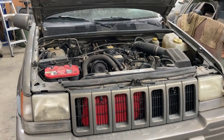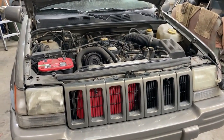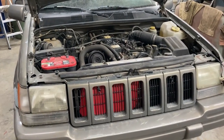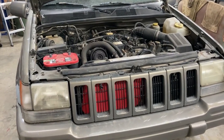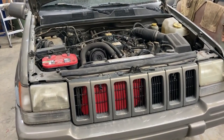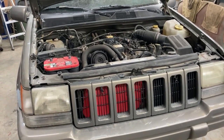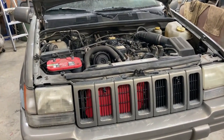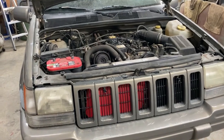I've been putting this job off for a while simply because I know what I'm going to be getting involved in. I can smell antifreeze in the cab. I pushed it last winter, driving this thing as long as I could in hopes of being able to use the vehicle before having to make the repair, and I got lucky. I was able to drive it throughout the winter, but the problem is you can smell the antifreeze — and when you smell antifreeze, that's telling you that you've got a leaking heater core inside there.